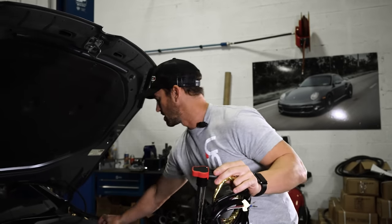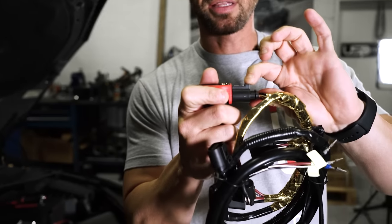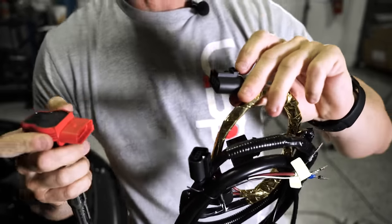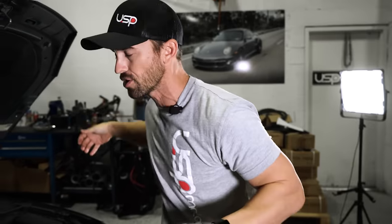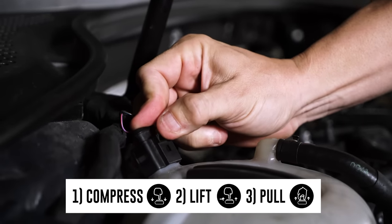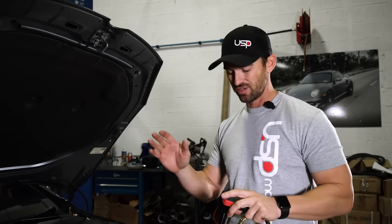The easy way to get these connectors off is that you cannot just press down on the clasp. You have to apply compression as hard as you can pushing inward. Once you do that, it will lift off and pull off. With two hands it's pretty easy, but the challenge comes when you're reaching down into the engine bay and you can't get it off and you're so frustrated you're about to break the clip. Remember: compression first, lift up, pull off. I promise you this video will help you if you're working on cars that have these connectors everywhere.